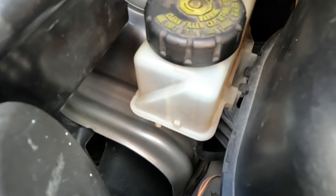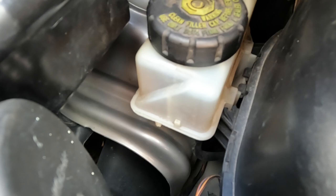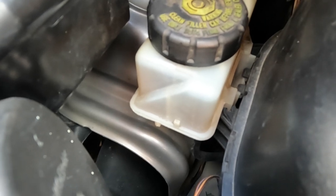It takes less time to bed in if you've done pads and discs together, and obviously more time if new pads have to adjust into old grooved discs. So that's pretty much it on this car in terms of brakes — it's had the front brakes done, the rear brakes done, and the brake fluid changed, so everything should be good for the foreseeable future. Hope you enjoyed the video, do feel free to like and subscribe, I'll see you again soon. Thank you and goodbye.